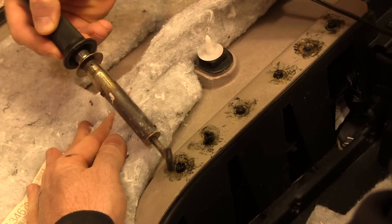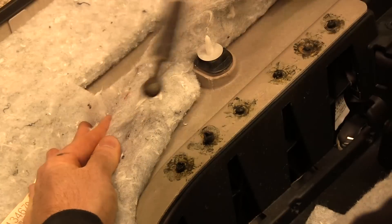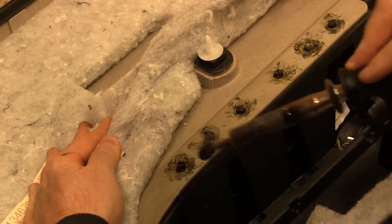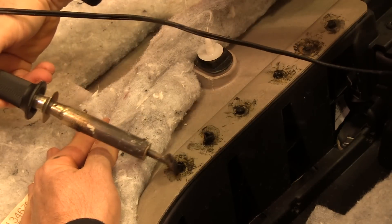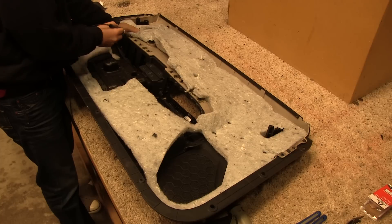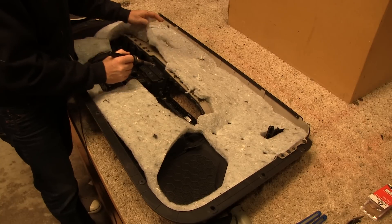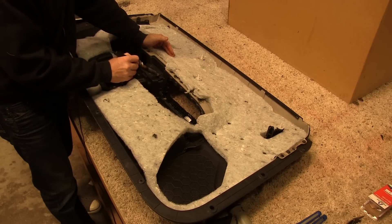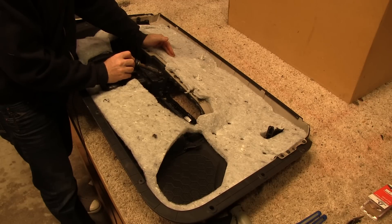Attempting to rebuild the vertical plastic welding posts allows the plastic weld to be pulled back through the door panel and potentially reused when we are ready to put the door armrest back in. This process of melting the factory welds into a reusable form is a painstaking task — expect to spend at least 45 minutes to an hour per door during this removal process. We prefer to try to salvage the original plastic welds to maintain the original structural integrity of the door panel and armrest.